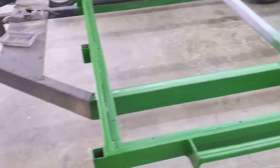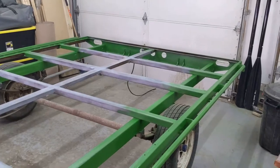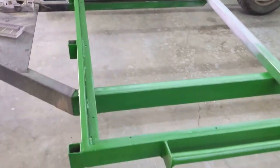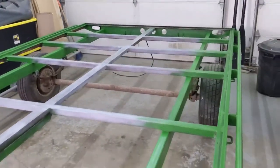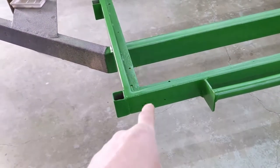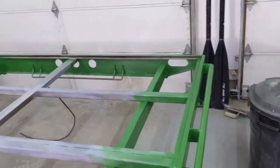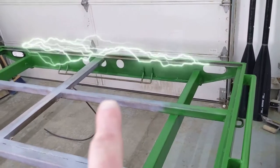While I have the decking off, we're going to get looking at and working on the trailer light wiring. First thing we'll do is get everything out and make sure we have all our supplies. When figuring out your wiring and lights, it's best to look at what is required by the government. With a trailer this size, I'm required to have marker and clearance lights — yellow lights on the front corners and sides, and red lights on the rear corners.